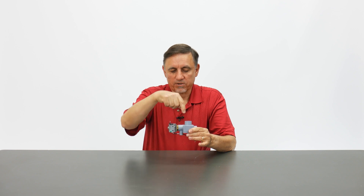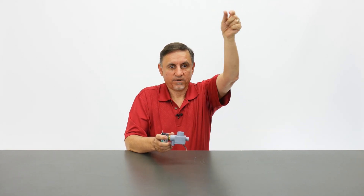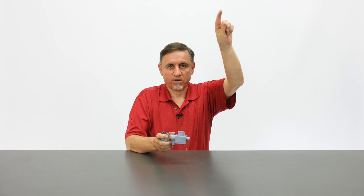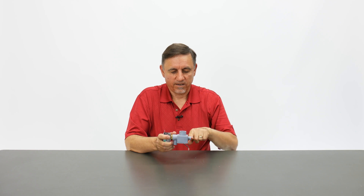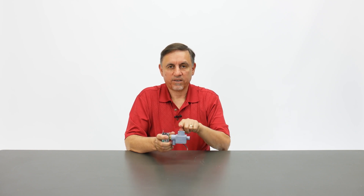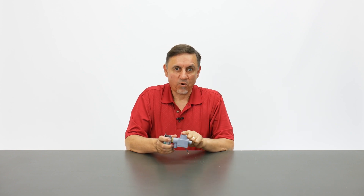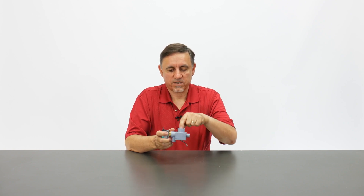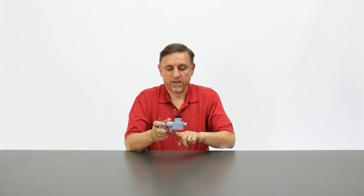Presently the port inside is closed from here to here, but it's open from here to here. The fill cup, which would normally be right about here, when the drain fill valve opens, water goes up to the fill cup, spills over, goes back down another hose to here, and because this is open to this, that water goes up and fills the steam cylinder from the bottom. When the unit decides it wants to drain, it opens this port to this port, which is the drain, and the water runs down the drain.